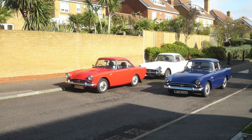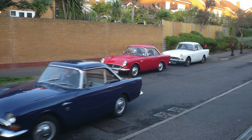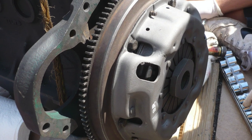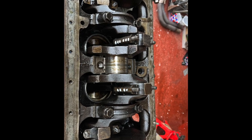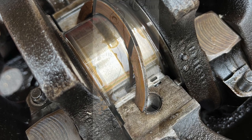I'm sure that if you have an Alpine you know this, but just for any new people who may not be aware: you should never depress the clutch of an Alpine when you start it. It's not like a modern car — if you do depress the clutch all you're doing is loading up the thrust washers, increasing wear and making it harder to start. So keep your foot off the clutch when you start it.